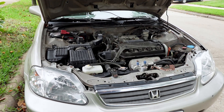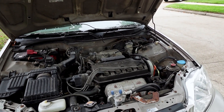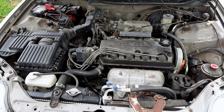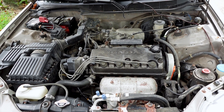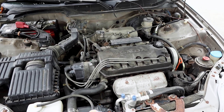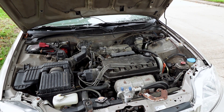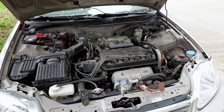Today I'm going to be changing out my valve cover gasket and also doing the valve lash adjustment for the valve train. The valve lash adjustment should be done every 10,000 miles — most people never do it. The main thing I want to show in this video is how to do the valve lash adjustment. I'll put a link in the description so you can read over it, but this video is so you can visually see how it's done.